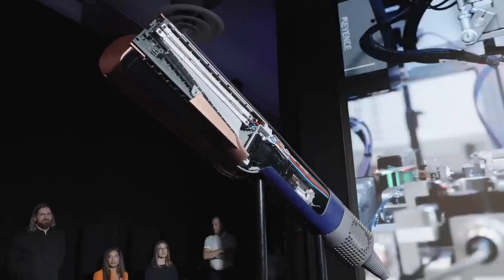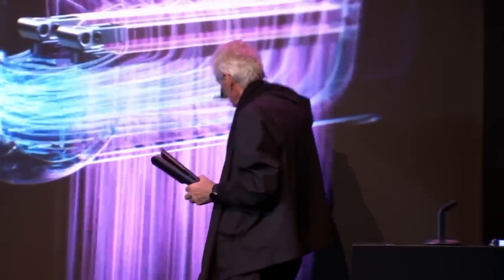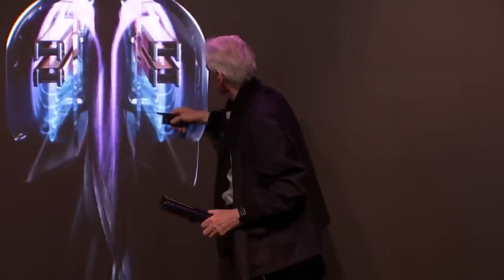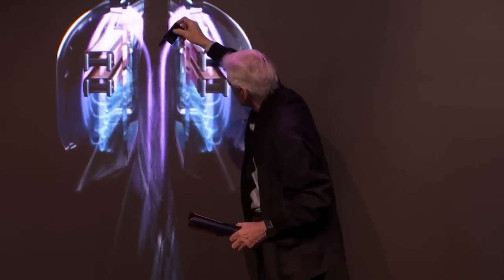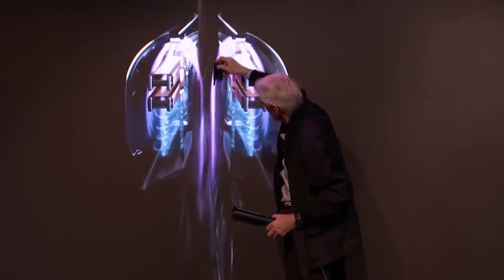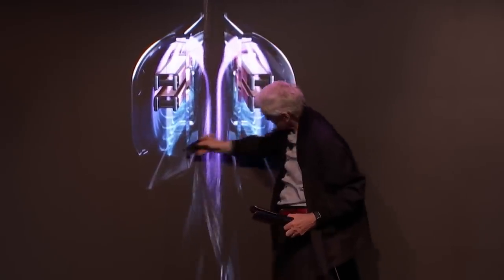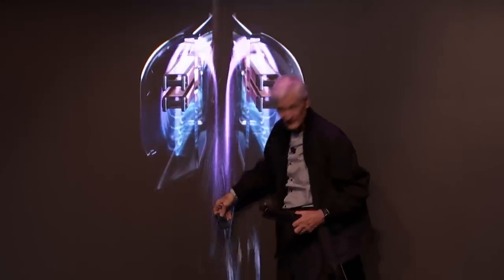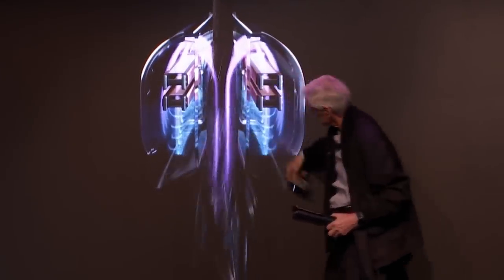I'll just explain how it works. There's the air going through the motor, into each arm, and then down each arm. The air's going through here, past the heater, at a 45-degree angle to the hair. And on the opposite side, there's also a 45-degree angle. Then it passes down and ejects out the side, so it doesn't ruffle the hair coming up. So it's ejected away at each side.